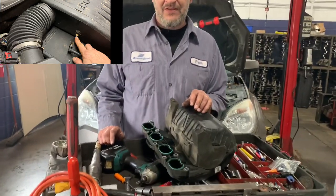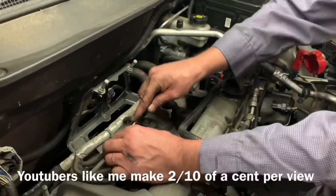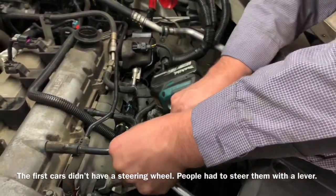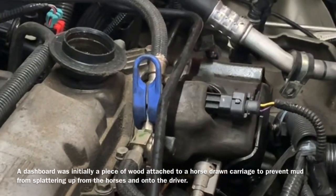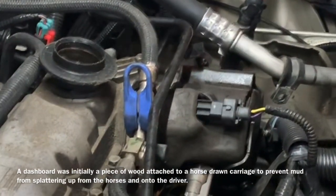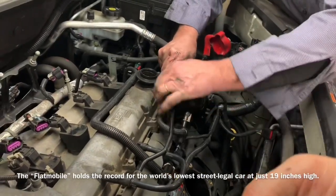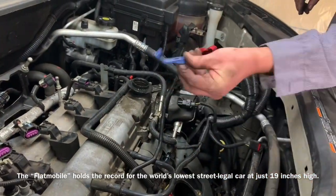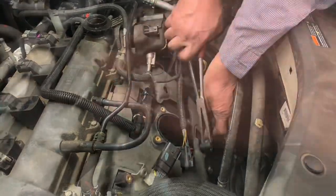That's interesting — thanks, Frank, we appreciate it, and I'm sure people out in YouTube land will absolutely love it. Now we're going to disconnect everything we can see on the top of the engine. Frank will remove all the bolts from the intake and remove the throttle body assembly. For the fuel line, you'll need a 5/16ths fuel line remover tool — a couple bucks at any parts store. You push the tool into the line towards you, push the line towards the tool, and then pull it back. Then with a simple set of pliers, work the hose off the line.